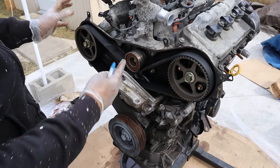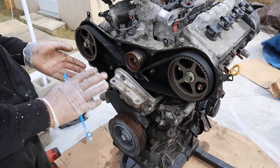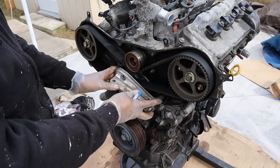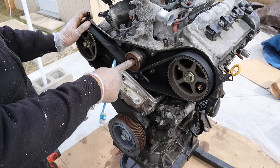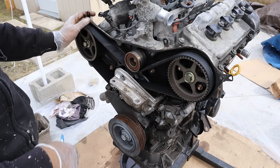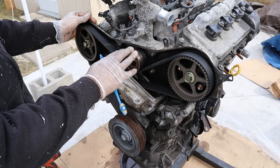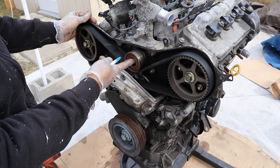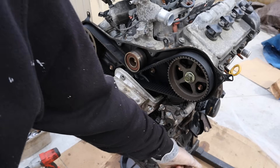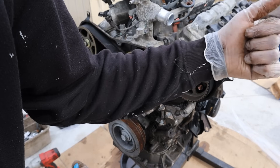Story time: 10 years ago when I was a complete noob doing my first timing belt job on my Lexus, I confused inch-pounds for foot-pounds on the torque wrench and over-tightened all the water pump bolts as well as this idler bolt. That bolt broke off and went flying into my uncle's face. Long story short, we had to tow it to the shop to dig out the broken bolt and all the other water pump bolts that broke. $500 later I had my car again. Lesson learned: only use your calibrated torque wrench.